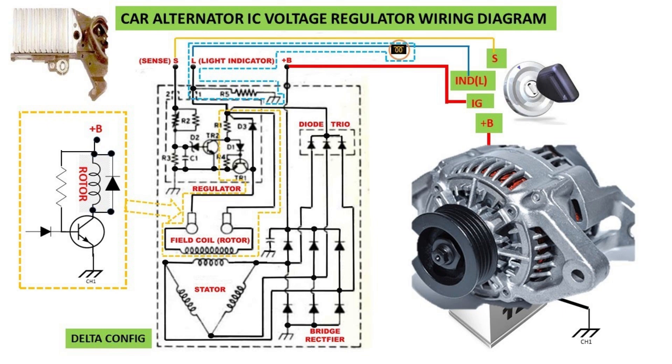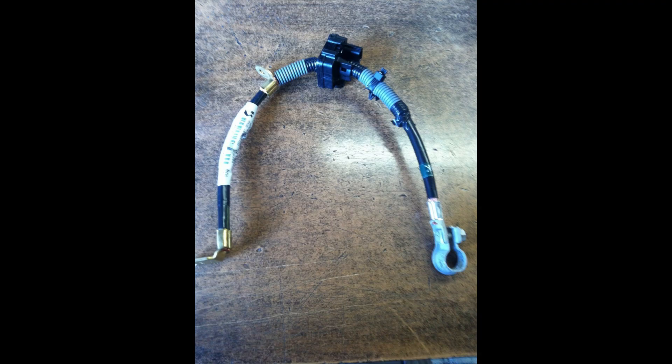In my book this is a win all the way around. I've never seen anything suggesting it shortens the life of the alternator or any other component. All this does is revert alternator control back to the alternator itself — the ECU is now out of the loop, and the voltage regulator built into the alternator, which was there as a failover, is now in control and running everything correctly. I've had no problems, no modules going bad, no bulbs blowing out. The doom-and-gloom crowd says it's too complicated, but I kind of really am an electrical engineer, so I've seen no trouble.